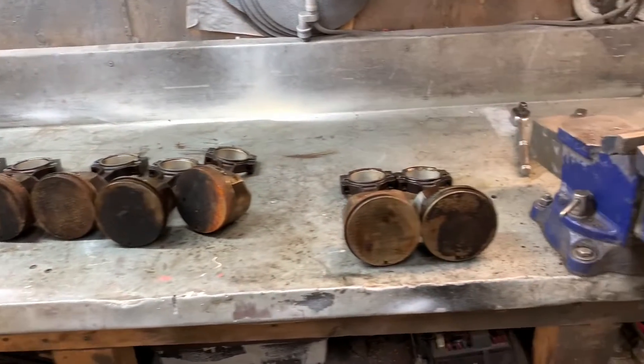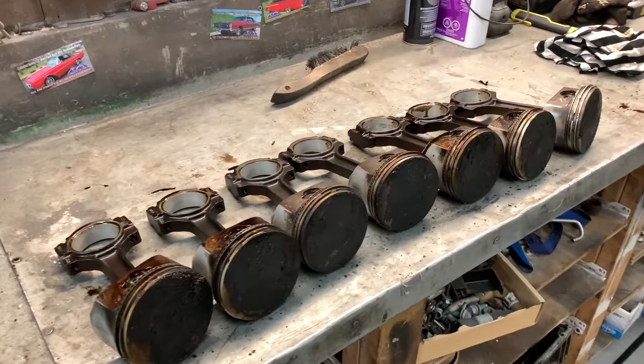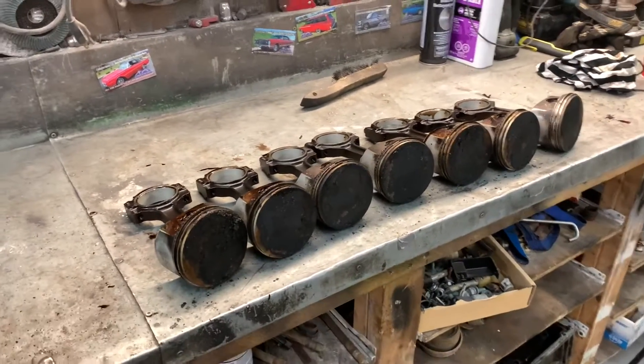This is just a guide for Gen 4 pistons. I didn't include the early Gen 3 pistons because they're press fit and usually nobody messes with them anyway. I've heard and I've read that it doesn't matter which way the piston goes on the rod, but it's nice to just put it back the way GM made it. So there you go.